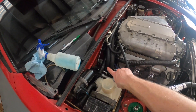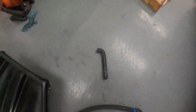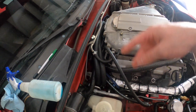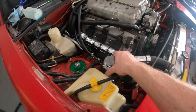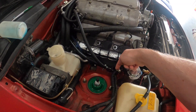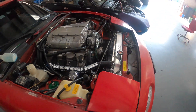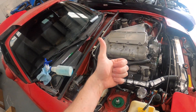I have now finished the heater core lines. I removed the 90-degree elbow on the 3/4 line — it turned out the elbow wasn't long enough for a hose to connect to; it was too shallow. Now I'm running a full-length 3/4 hose all the way over directly into that port. The 5/8 side is still configured the same as before. I also bent the hose barb outward slightly to give a little more slack. For the power steering reservoir, I mounted it here by bending the bracket slightly, then used a flange-headed 10mm bolt with an 8mm body, cut the flanges off two sides so it sits captured in the groove, and put a lock nut in the back. Heater core lines — completed and installed.